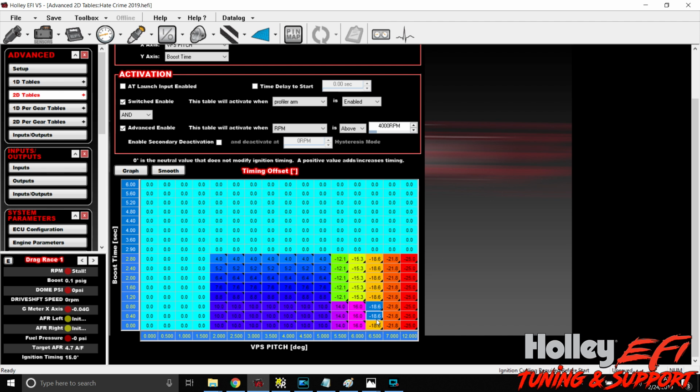And again, these numbers I'm pulling out of thin air, so don't take these as the gospel. And all of this stuff can be adjusted however you want. If you find yourself in a situation where the car just doesn't ever really, the pitch never really goes anywhere, it's time to hit it with more power, right? So make it rise. Make the front end start to travel with more power. Get the power in earlier, get it sooner. So that's how you're going to get faster, is getting the power in quicker.